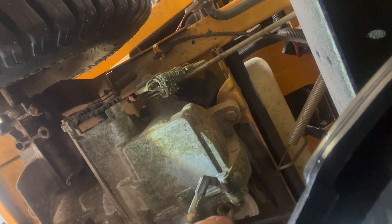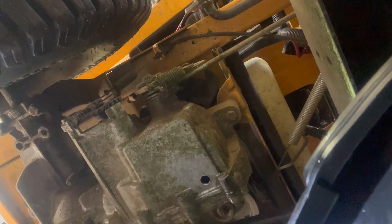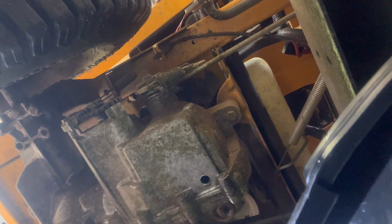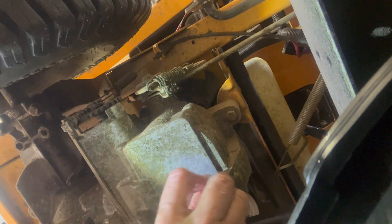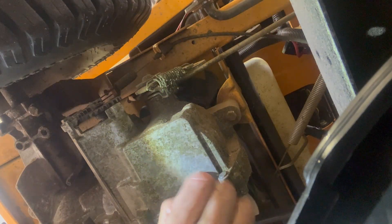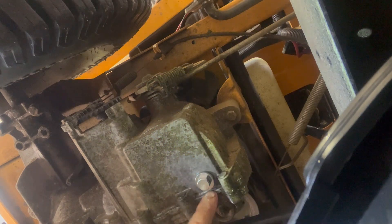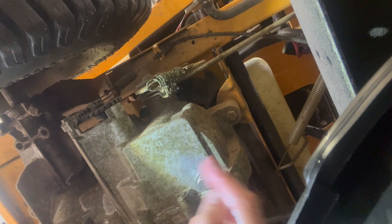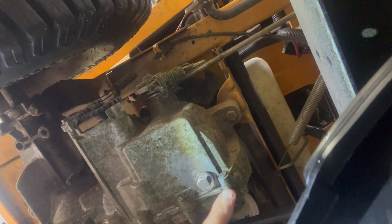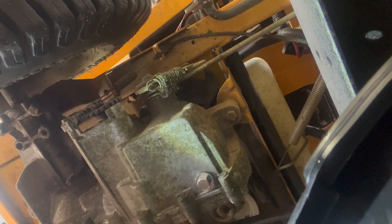That's feeling really good. Let's give this one more shot. There we go — see how easy that went in? That's what you want. Now it's threaded and making really good contact on a flat surface. Like I said, you don't want to be too far over either side — you want it right on that flat surface in the corner of the transmission.